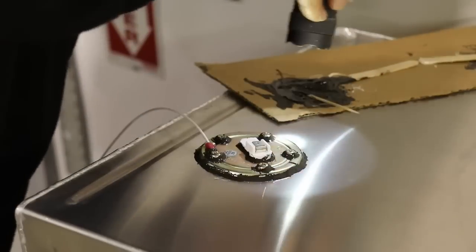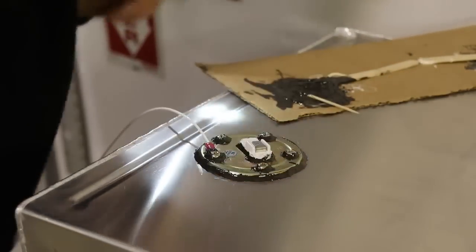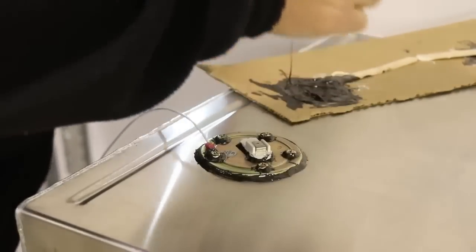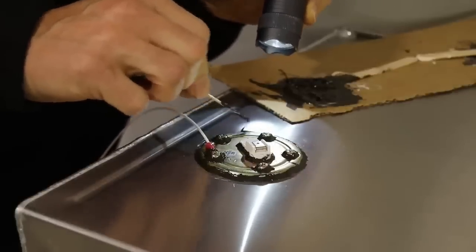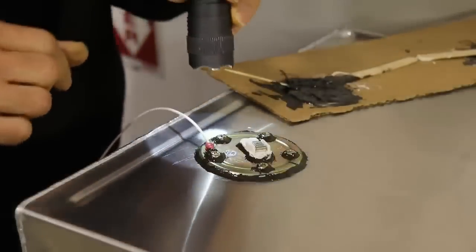Hopefully the Pro Seal will stop any further leaks. I'm also spreading a little bit around the perimeter of the screws and around that white plastic center section on the fuel sender. When I'm done, I like to take a real close look with a flashlight at the Pro Seal, because it is easy to miss a tiny spot or have a pinhole that isn't quite covered. Inspect it really well.